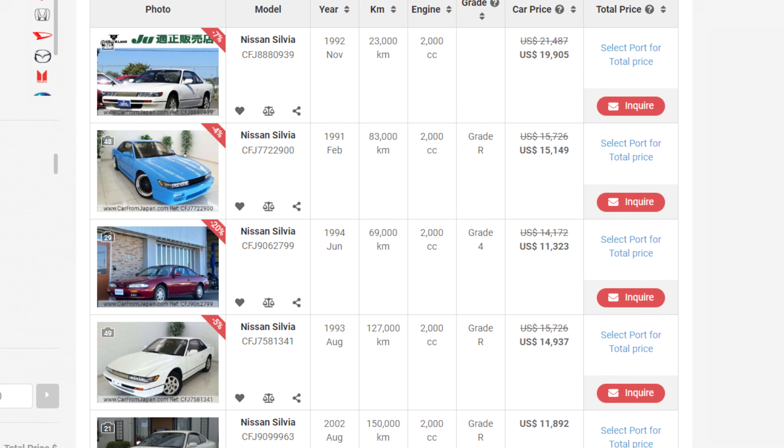So let's just talk a little bit about power to weight ratio. This engine makes 650 horsepower. Currently the car is 1,600 pounds. This thing will still be well below 2,000 pounds with me in it, which is good because then we can add a bunch of weight and ballast the car how we want. The car is so light everywhere that we can put weight anywhere we want and the car will still be underweight. This has 650 horsepower on pump gas, 600 foot-pounds of torque — a very reliable power plant.